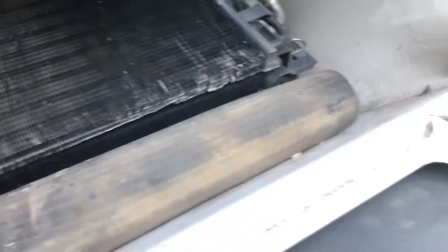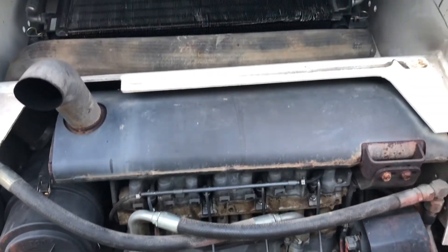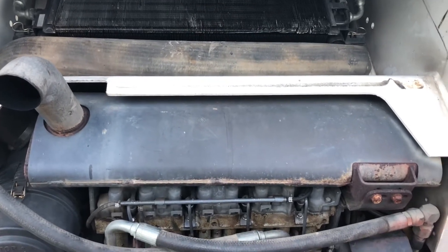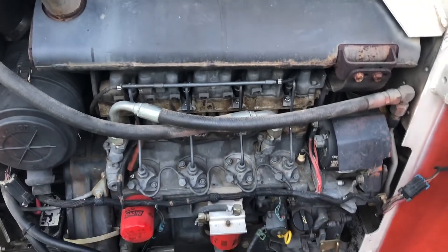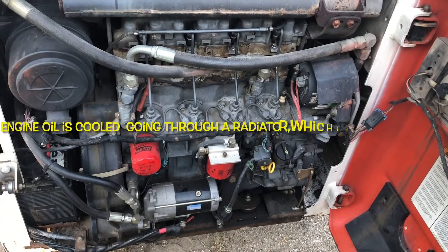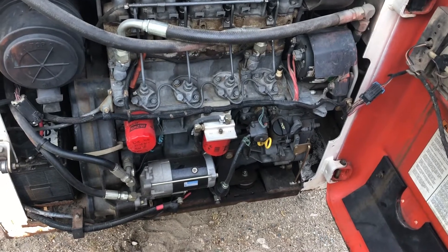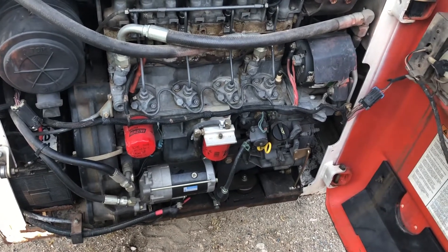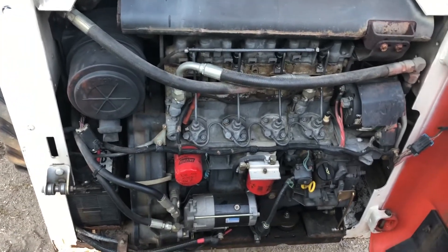You can pick them up one at a time, flip them over, clip them over, and clean them all nicely. Now mine — I did that and it's still overheating. It's cooled by the engine oil. There's no other cooling system on here; it's air-cooled. That cleaning wasn't the answer, so I'm going to wash it all out and dig deeper.